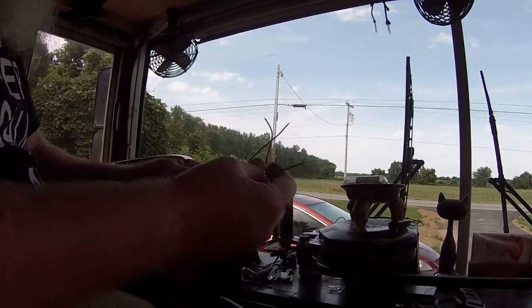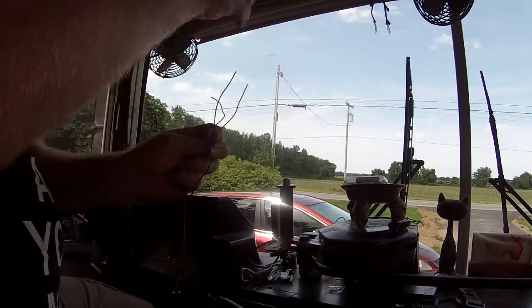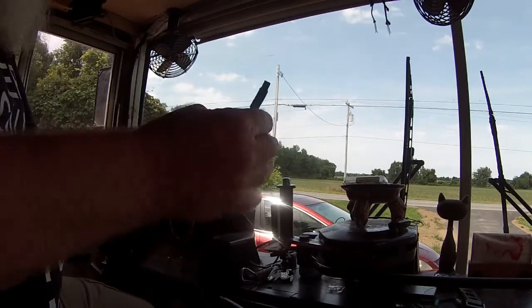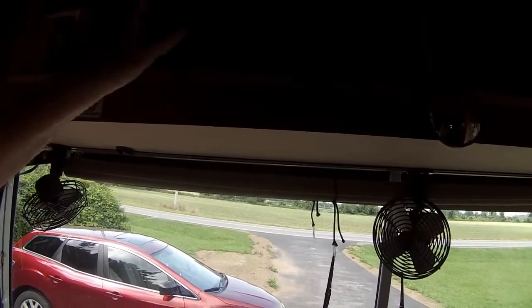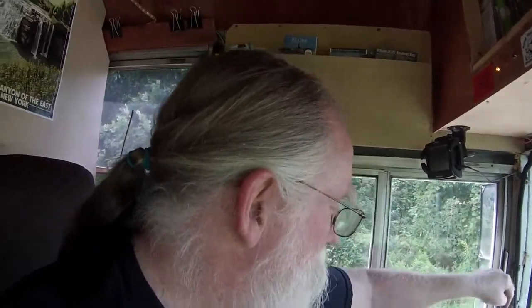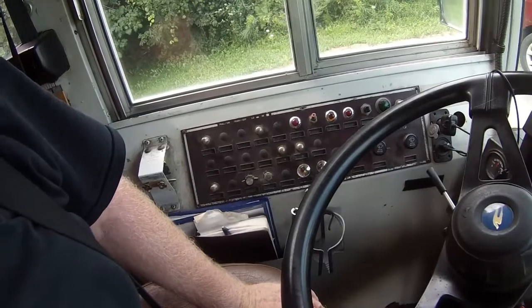Up front I'm doing things a little differently. This one's got red for power, black for ground, and this blue one would be hooked into the reverse circuit. By not putting this in I can just power it up and it should work. I only need to drill a smaller hole here. I'm not going to tie into the lights because of the way I put this bulkhead in — it'd be in the way. I could cut an access hole but I'm not going to do that right now. Instead I'm going to tie into the fuse panel like I did with the fan, run inside and all the way down to where all the electrical stuff is.